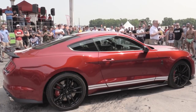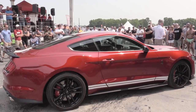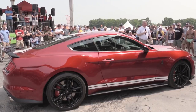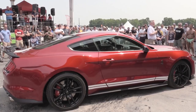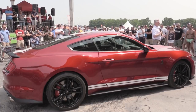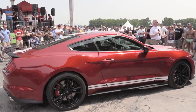And then we look at the brake system. One way to think about it, the front brake is 16 and a half inches. There's 1965 Mustangs out here today that their entire tire isn't that size. And why that came about, and if people drive 350s, I mean, you don't fade the brakes on a 350, but we've had to upsize the brakes on this vehicle to have that same performance of no fade, so you can get an idea how much faster we're going on the track, that we need that increased capability of braking as we go into it.